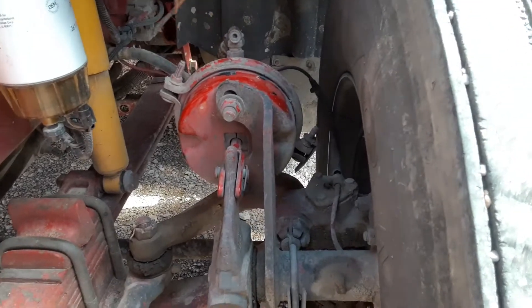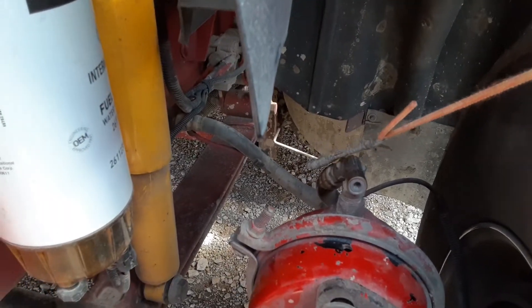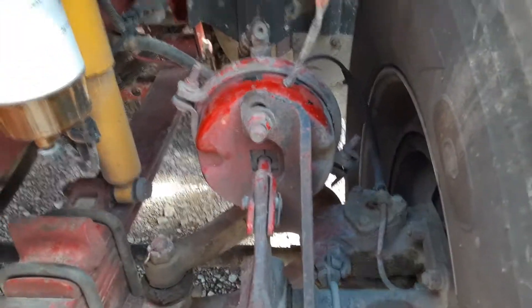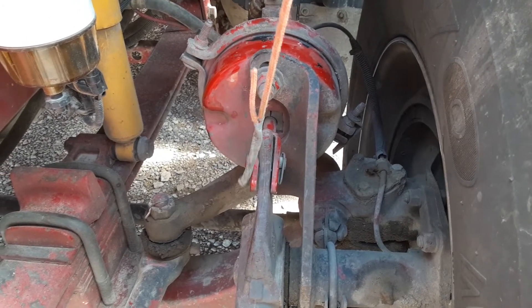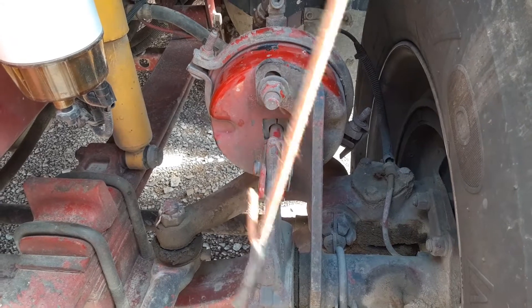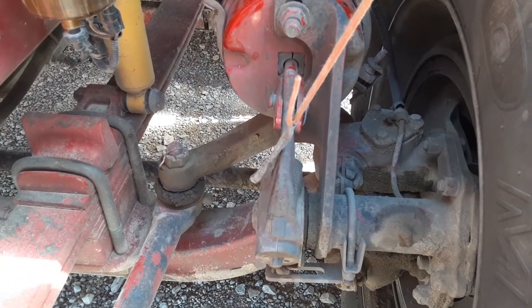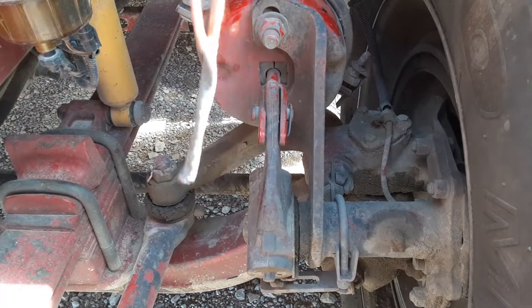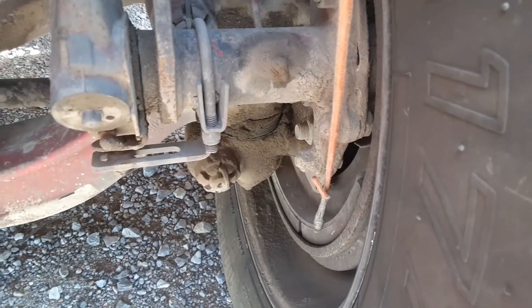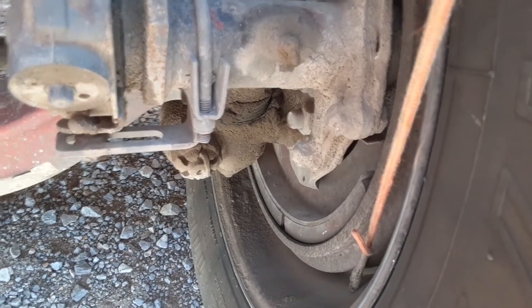Now the air brake system. Check the main air line going to the brake chamber — no holes, no leaks, not rubbing on anything, and connections are tight on both ends. The brake chamber — all nuts and bolts are in place and tight, no leaks, and no unnecessary holes. The push rod — make sure it's not bent, not broken, it is secured to the slack adjuster with a pin and cotter key. The slack adjuster is also not bent, not broken — pull on it to check the adjustment, should not move more than one inch; if it does, the brakes need to be adjusted. The brake shoes should be at least a quarter inch thick, not broken, not missing, and not soaked in oil or grease. The brake drum — make sure it's not bent, not broken, not soaked in oil or grease.